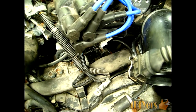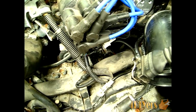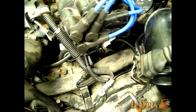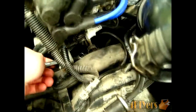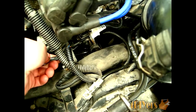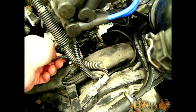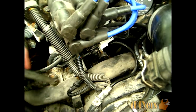If you are replacing the sensor, the only tool you'll need is a 10mm wrench — I found a wrench actually fits in there not too bad, though it is a fairly tight space. All it has is one bolt closest to us, with the sensor on the other side. Simply take the bolt out and the sensor just slides out of the casting.